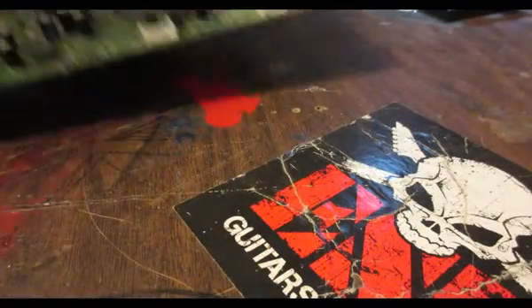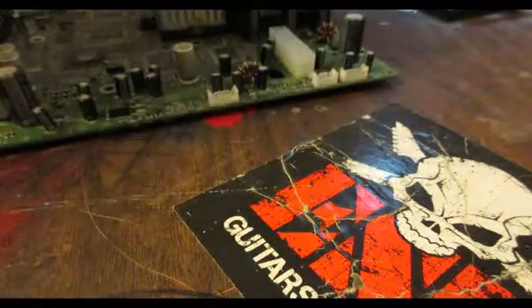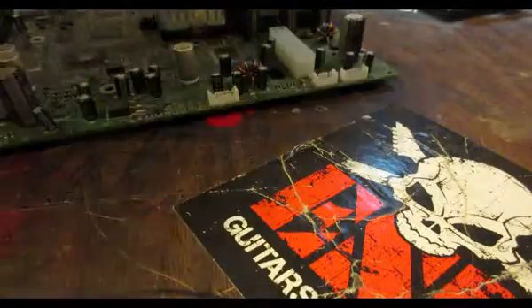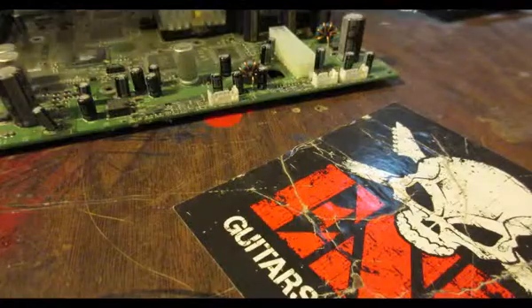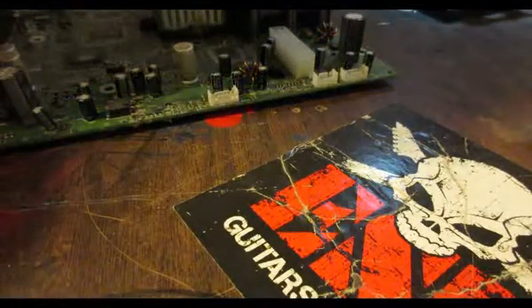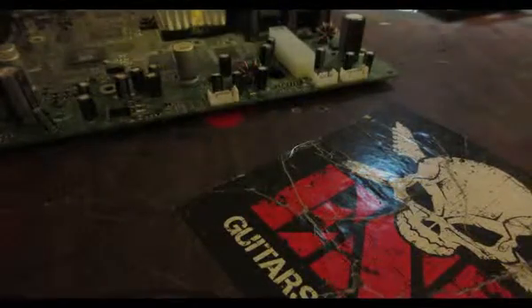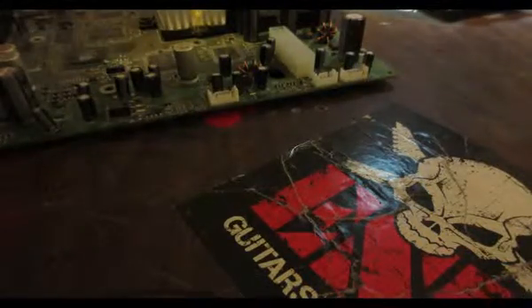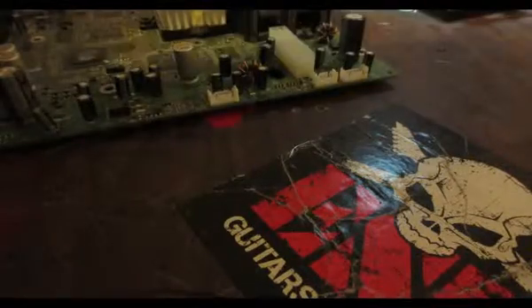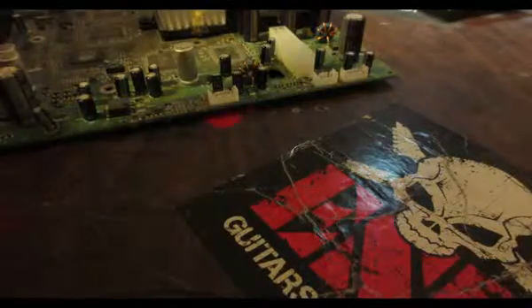The clock capacitor has now been removed. That's basically the video, guys. Now you won't have to worry about that ever leaking and spewing onto your board and corroding everything. Look it up — it happens all the time. Version 1.6, you guys are lucky, kind of. You can't do a TSOP flash, but you don't have to worry about this. Hope you enjoyed it. Thanks for watching.